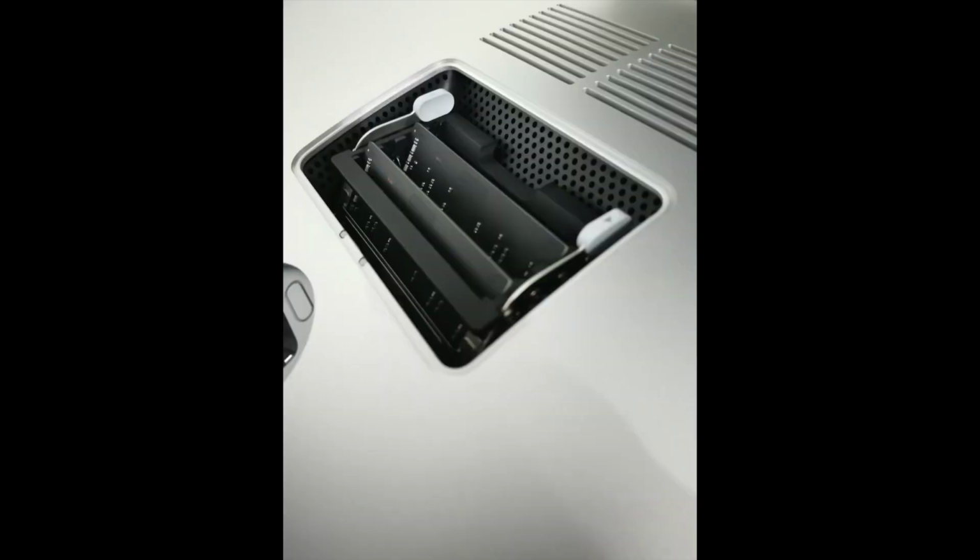So here's the slots that hold the RAM sticks and the arms, and you can't really see it well here, but there are arrows on those tabs that are pointing outwards. There are 4 RAM slots. That's not easy to see either. The RAM has been installed at the Apple factory with a 1 slot gap in between the RAM sticks.